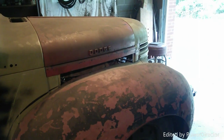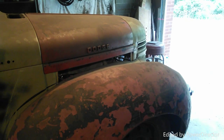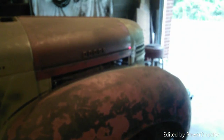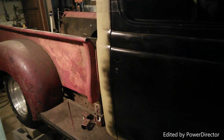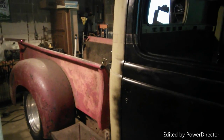I just want to make sure I'm good side to side again. I'm good there, I'm good there, I'm good there - so now I have a level line. My door's a little off and looks like it needs to be jacked up through the hinges, but the body line looks good all the way along. Moving back, the laser is just about touching on the bed. Since I cut the bed four and a quarter inches, the top of the bed lines up with the body line. But at the rear I'm low about half an inch, so I have to shove some washers in.